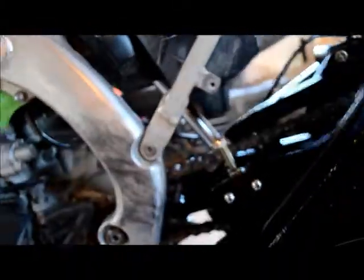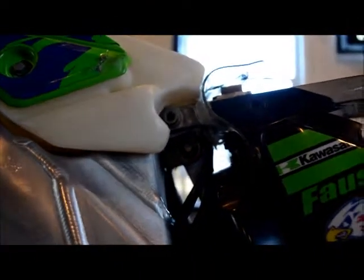Mainly, the biggest part in hooking this thing up is your strut tower, which goes to the top of the strut, or the shock, where the shock was mounted. Hopefully you can see that, which attaches down in here on the Timbersled, and then the balance of it is hooked up right here on the swing arm, the spindle that goes through the motor there. So pretty amazing how simple that is. Works great on the KX.